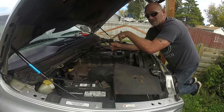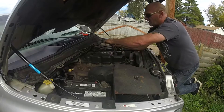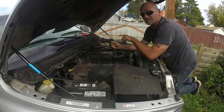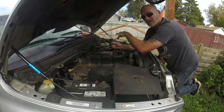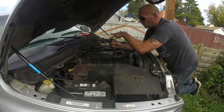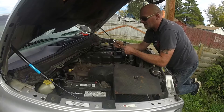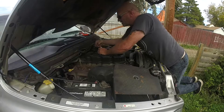This is something you can do on any of the 5.9s. The 6.7s have a slightly different valve lash. For the 5.9, between the min and max for the intake and exhaust, you end up wanting 10 thou intake lash and 20 thou exhaust lash. I set them cold and they get nice and happy and they run super smooth.